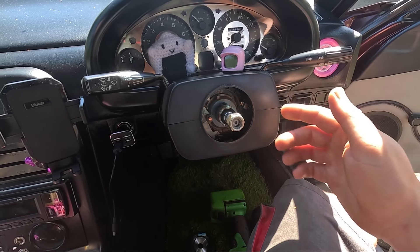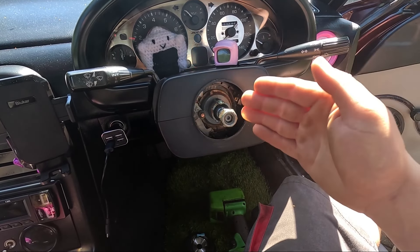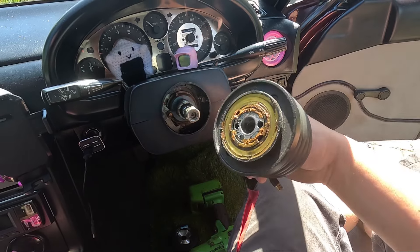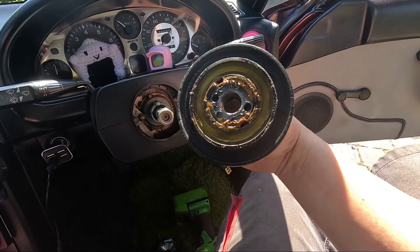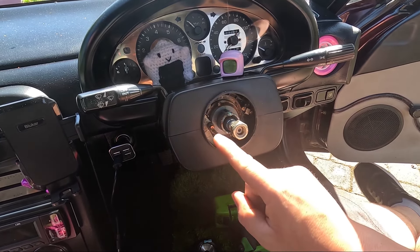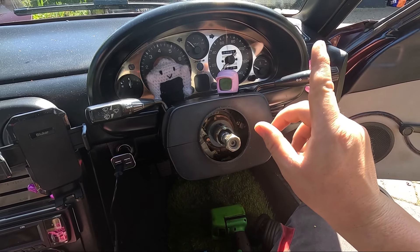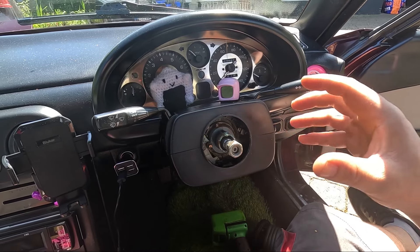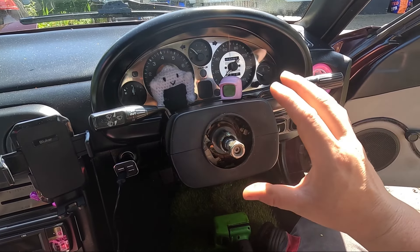If you've got a Mark II or a model with an airbag, there are a few extra steps here to keep your horn working. On most Mark I's there's a little spring contact which runs on the brass contact on the back of the steering wheel — that's the positive for your horn. The Mark II is slightly different and there's a trick I'll link in the video above. If you've got an airbag, your aftermarket steering wheel likely won't have one, so you'll want to put a resistor in the airbag wires — now is the perfect time to do that.